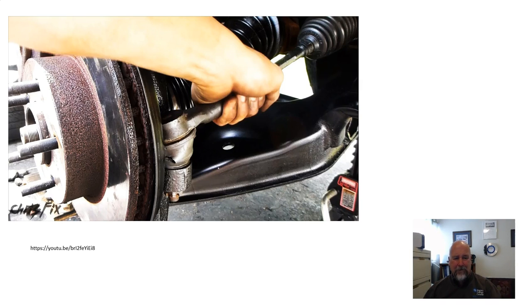If you hear crunching and grinding noises, that indicates a problem. If you can't rotate it at all, that indicates a problem. So we want to see basically smooth movement with some resistance, but no play in any of the connections. Now, if we look here, this outer one, you can grab it with your hand, pull up and down, see if you can make it move. Try to feel for a clicking kind of something that would indicate play in the joint.